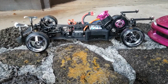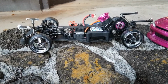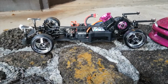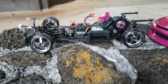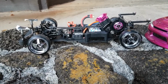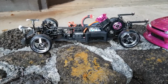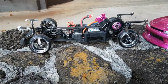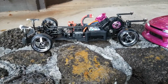With the oil in the shocks, of course, the front doesn't really dive like how it used to, but the car overall remains a lot more planted. And I think going forward, depending on how many turns the track has, I'll probably keep both sets of shocks, because for a track like you'll see tonight, Alan laid out a track that's got a bit more switchbacks and stuff in it. I think the heavier oil will help with that, just allowing me to drive the car smoother.